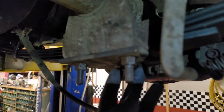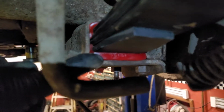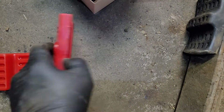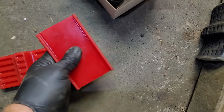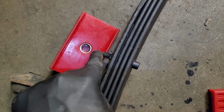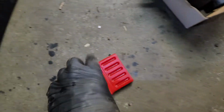See the new insulators. Your plate is here at the bottom. There's your nut sticking through. Do yourself a favor, if you're using these polyurethane insulators, punch a hole with the drill bit through the bottom of this one before you put it on. It allows the nut, the stud, what's left here, to poke through and hold this in place. This one is the top one.